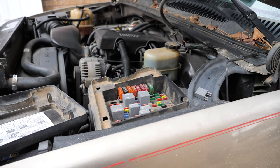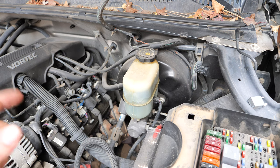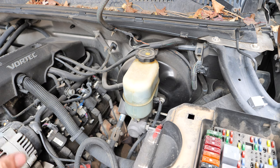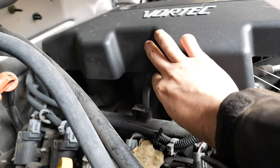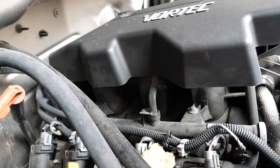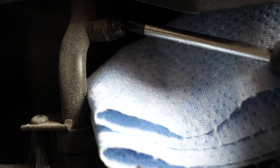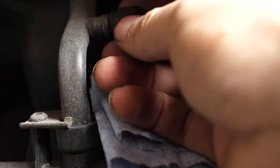With the relay out, we can just turn on the car. The car did not even start, which means there wasn't much fuel in the lines to begin with. Hopefully by revving it a little bit, that caused all the fuel to go out of the lines. There's still going to be a little bit, so we're going to drain that off of the Schrader valve. Over here on the side of the engine, the Schrader valve is located just right over here. We're going to pop off this cap, put a rag underneath, and then poke it — just like how you would a tire — and have all the fuel drain out. I'll put some super absorbent towels underneath and poke the little valve. It looks like we have absolutely no more fuel in the line, so I can cap this back up and move on.